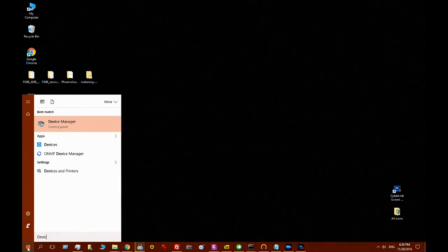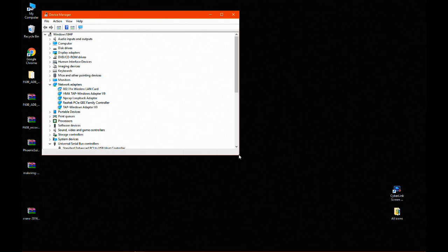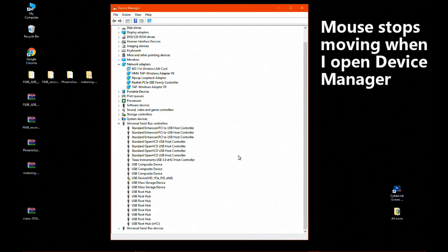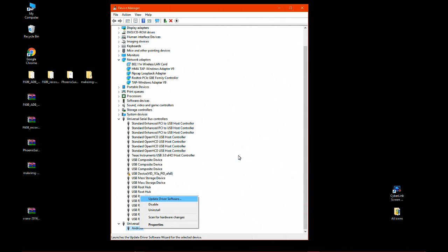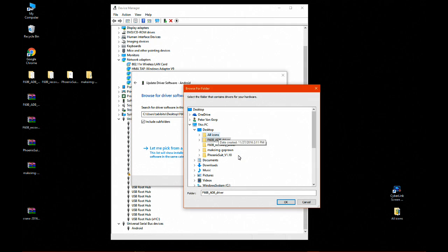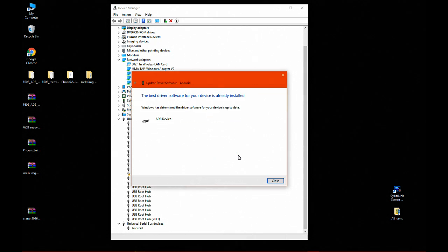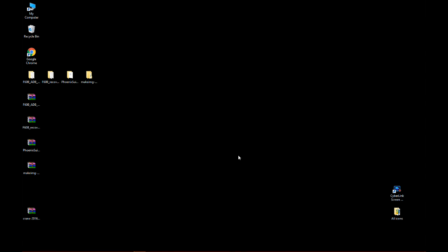We want to use Device Manager. Open Device Manager to look for the USB device of the camera. Usually scroll down to Universal Serial Bus Controllers and Universal Serial Bus Devices. On the bottom is the one called Android. If this is marked or it seems to be not working correctly, right-click, Update Driver Software, choose Browse My Computer for driver software. Browse to the desktop, find the F60B ADB Driver folder, select it and click OK. Click Next, and it's good. If this step does not work, try it again using the same driver or different drivers. Links are below in the description.